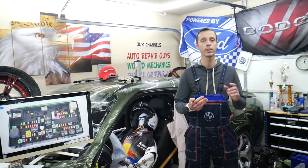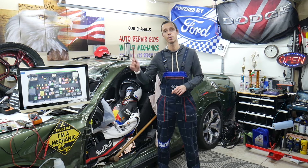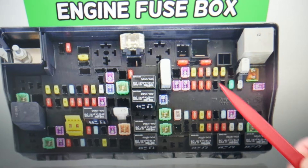Other things that can cause a headlight not to work: you may have the wrong size headlight bulb — sometimes they look very close or almost identical but could be different part numbers, so make sure you have the right one and plug it all the way in. Check the connector behind the headlight — it may have moisture buildup or dust, and it's supposed to have a big seal on the inside. Make sure it clicks and you can't unplug it. Also, if you replace a bad bulb, it can sometimes trigger a message in the body control module that requires a code reset. If you don't clear the code, the headlight may not work. We see that happen on Dodge vehicles.